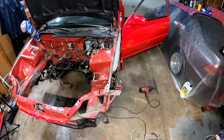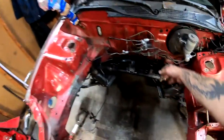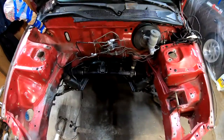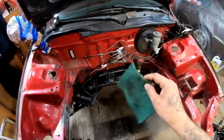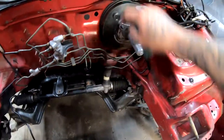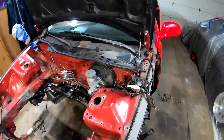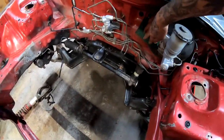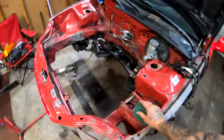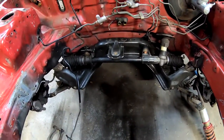So it's been over an hour, and I went ahead and pulled all the lines off. As you guys can see, I did that off camera. Everything's off. Everything's nice and clean because I hit it with this right here, not to clean it, but to scuff it up, all of this. Then I hit this with 180, I hit it with 320 and I hit it with 400. I also took this right here. I hit all of this and I also hit this guy afterwards. And down here, I used a Scotch Brite just to scuff everything up.